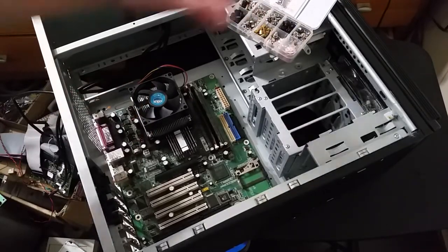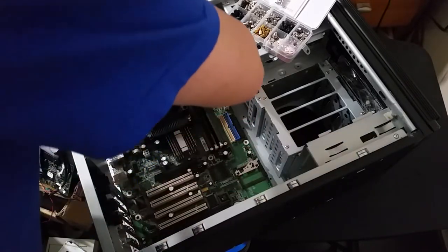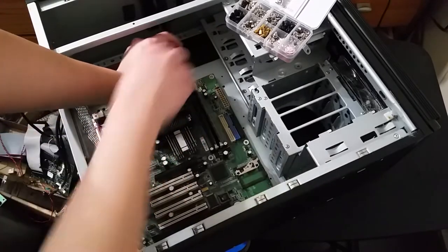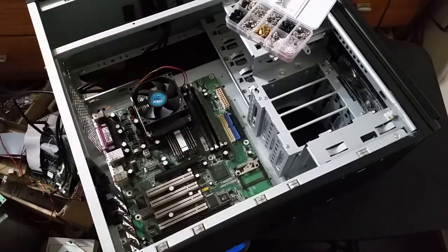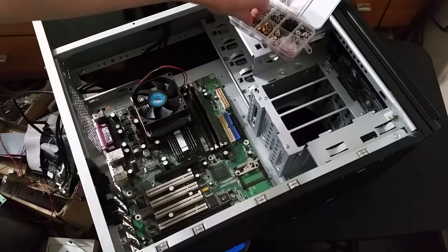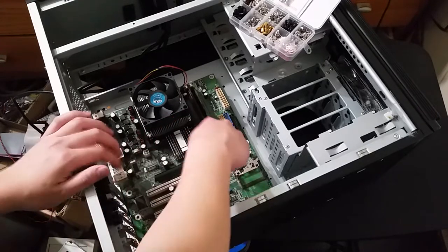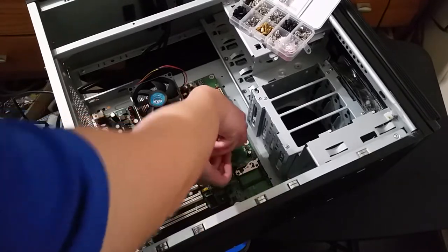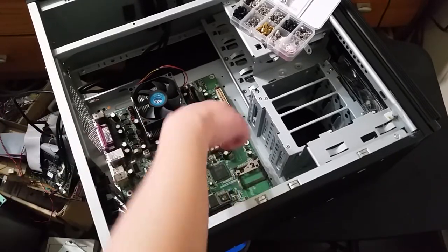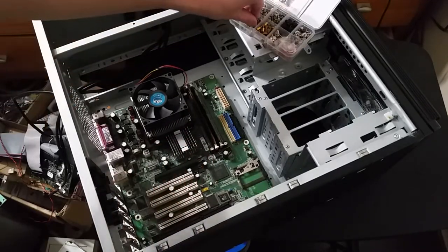And because this is an archiver system, that's gonna mostly be handling drives, and those drives tend to be pretty 12 volt heavy. We are gonna be using a relatively modern power supply. And that power supply in question is actually just the one that I normally use for all my testing, because it has both a very strong 5 volt and 12 volt rail. What's that? I think that's just a bit of sticker residue.